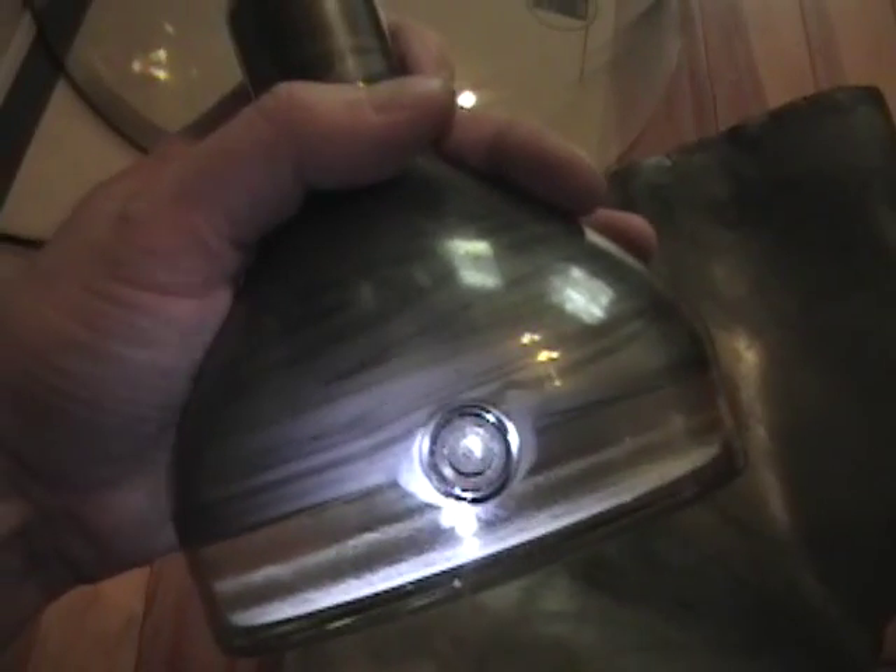Now this poses a couple of problems. A traditional all-glass CRT connected the high voltage with a little button and a heavily shielded wire. But on these, because it's all metal, they attach the high voltage to the entire metal cone — quite dangerous, as all these warning labels indicate. While the set is operating, this entire cone is at about 17,000 volts, and if you were to reach in and come anywhere near it, you're going to get one hell of a shock.